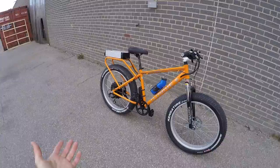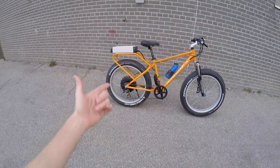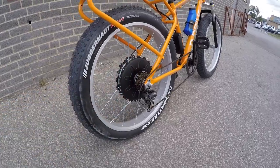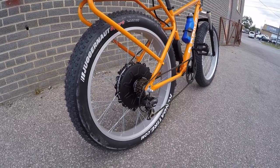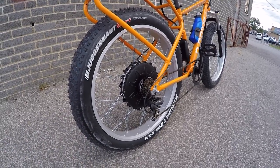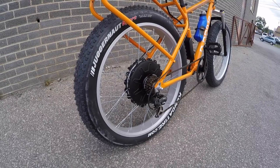Their warranty is decent — about a year on the frame and on the motor, which in this case is a Sheng Yi sort of gearless direct drive, 500 watt. This reminds me a lot of the Rad Rover, which has a very similar motor. Being gearless, it's a little heavier and has a larger visual footprint. However, there aren't gears inside that might rub or overheat if you're climbing a lot — these are supposed to run a little cooler. They aren't going to be quite as peppy from a stop because you don't have gears helping convert energy into torque.